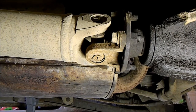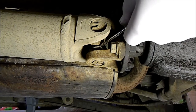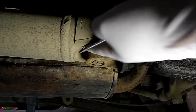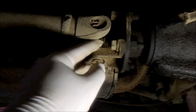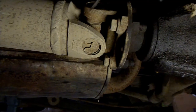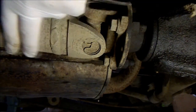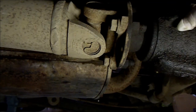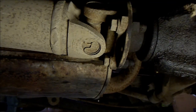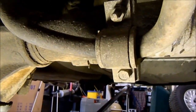Another thing to look at actually, as we can see in here, these rubbers on the universal joints, if they're perished or missing, it's also grounds for a roadworthy failure. That's probably a better view there. I'm talking about these rubbers up here. They all look alright. I've also given this thing a bit of a turn, and there's no free play in there, but that's very important too. As far as this sweating around the pinions goes, the diff has plenty of fluid in it, and so that's alright. I would just be inclined to wash all that off. Sway bar bushes look alright.